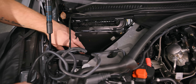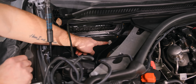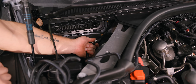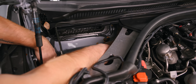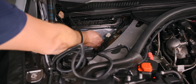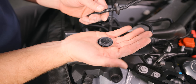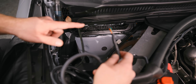Luckily in the M4 it is completely open. On some cars like the G20, they do have an extra battery here. To make it a little bit easier, remove this little white connector — that just holds the wire harness onto a screw — and then you can move this out of the way. This is the grommet that we're going to be replacing. Just reach in and pop that out. As you can see, Dorch already has a pre-installed one that you're going to use instead of the factory grommet.